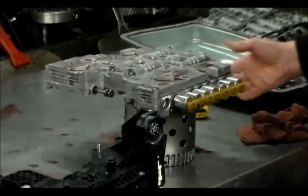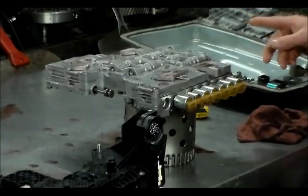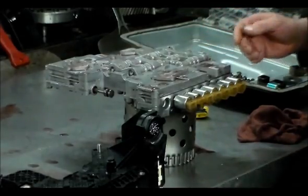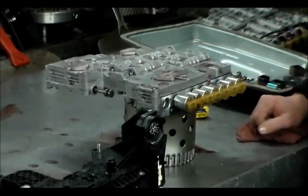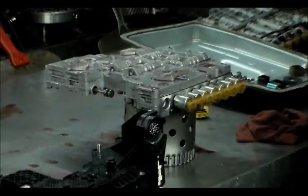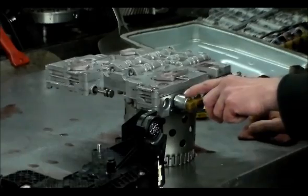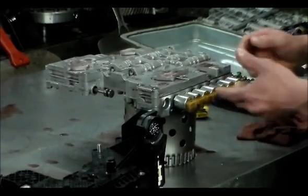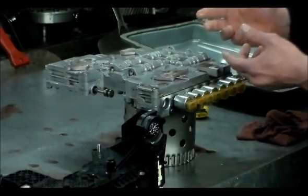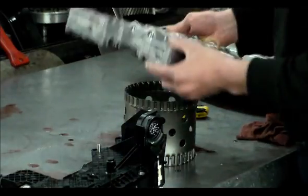So what we're going to do now is install the new one and bolt it back up. When you drop the valve body, a thermal element comes out, which I'll show you the correct way that goes in. Now, these solenoids — it's a whole big thing. I think there's a band number on the solenoids, and there is a number etched in the valve body, and a number etched in the side of the case. If you want to change an individual solenoid, you go by the part number. If you want to change the valve body, you have to go by the production numbers — I forget the exact technical name.